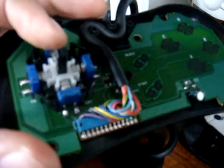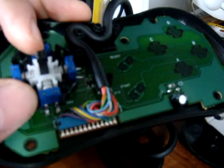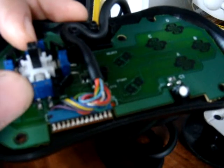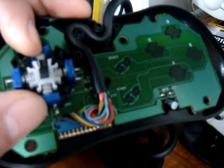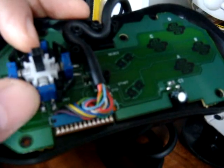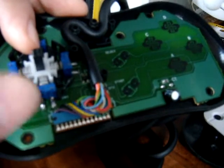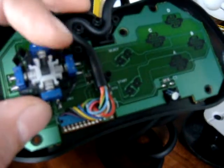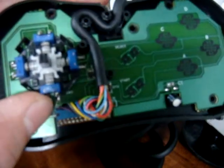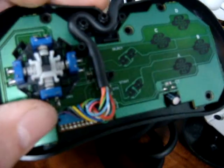That's one of the downfalls. But the way you can rectify the situation is with these switches here — you can probably go down to your local Radio Shack or something like that and pick up a switch. It's not that expensive; these things probably cost a dollar a piece, maybe even less. They've just got two contact points on them — you can desolder them and solder in a new switch and be back to playing. They're not totally hopeless if you get a bad controller; they can be salvaged, but you just have to find the right switches for them.